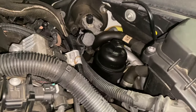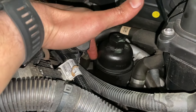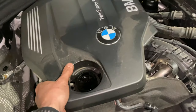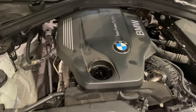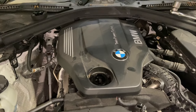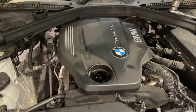That's the filter cap properly torqued up now. 25 Nm doesn't look too tight on a plastic cap, but it's correct. Just like underneath, give it a quick wash off with brake cleaner so you can clearly see if it's leaking. Pop the engine cover back on and get the oil filled up — it takes exactly 5 litres of 0W-30 fully synthetic oil. As an alternative, it does list that you can use 5W-30 fully synthetic as well. I'll put links in the description to where you can get the right stuff.